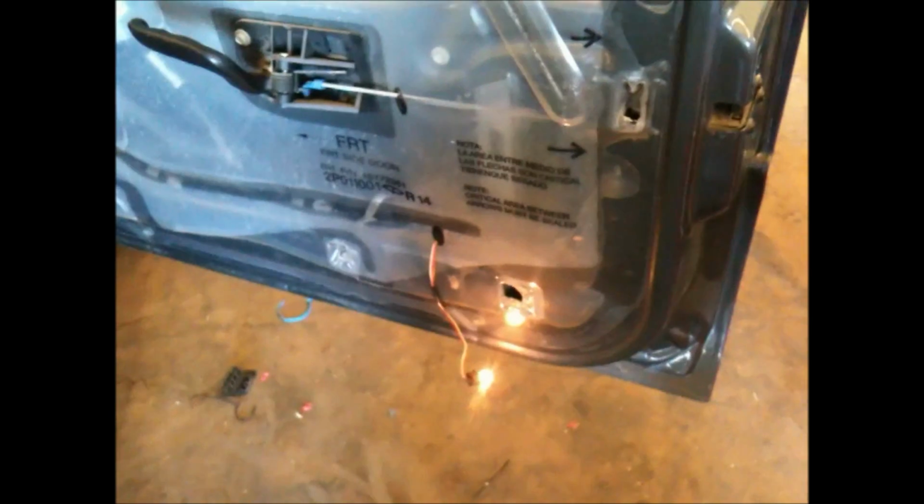And right here, what I did, you could see those little silver dots. Got the Rockford Fosgate, and like I tell you guys, mock it up, line it up, and right there it is. Those are the bolt patterns right there. It's a double-ended 1/8-inch pilot drill bit, and go ahead and punch these holes out, and then go ahead and screw it down to the door panel.